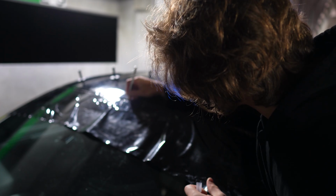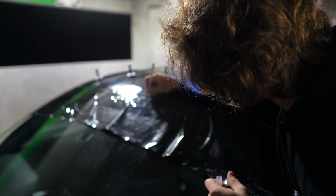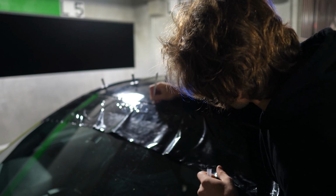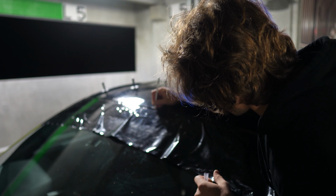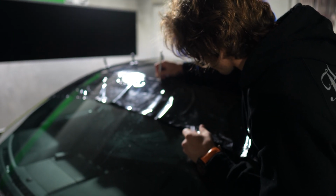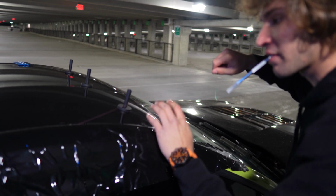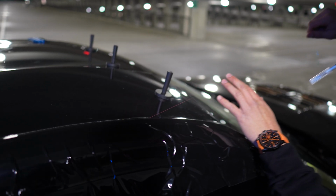Lay it, and pretty much you lift it once the wrap is done. This is a part that I really messed up last time. Well, actually I didn't mess up, but I didn't really pay that much attention to it. I'm cutting against the glass and I'm holding the blade in a specific manner. This keeps a steady hand and you just go against the glass the entire time. You don't need to put the blade deep down in there. This is the knifeless tape cutting the wrap.